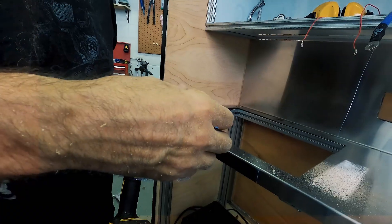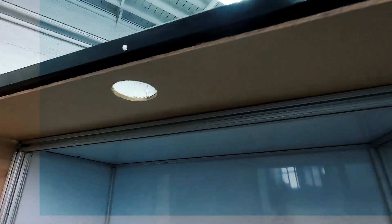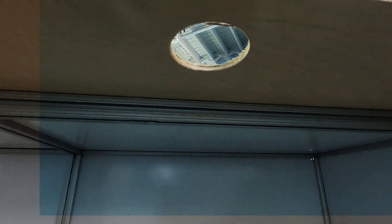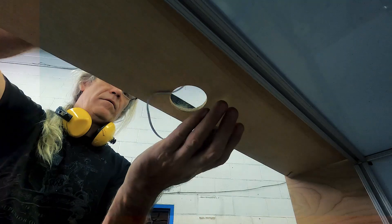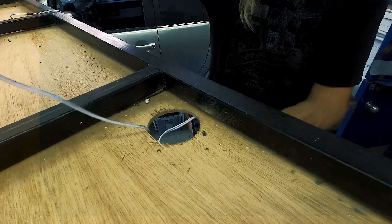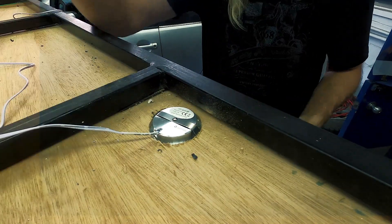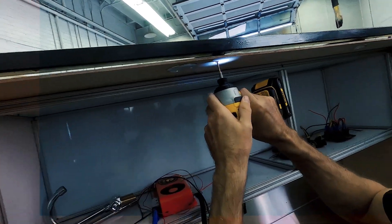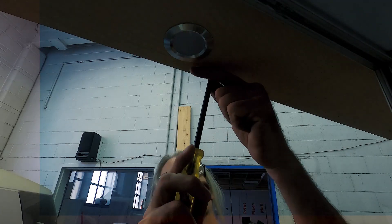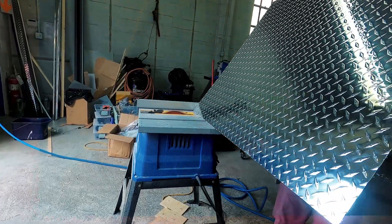You can see the Dremel bit was just completely pulverized by the stainless steel — that stuff is tough. I had two extra LED lights and I knew I was going to use them in the galley, so I chose to put them there. I used a simple 2-1/4 inch hole saw and they just literally pop right into place, then I had to thread the wires back to the panel. I drilled a couple of holes to hold up the ceiling — I did have some VHB on it but it seemed to be letting go over time since gravity was doing its thing, so a couple of screws helped that out.